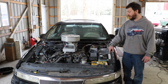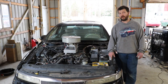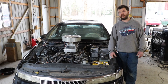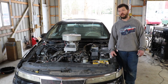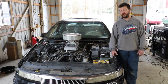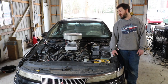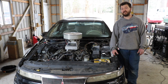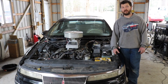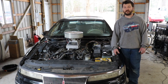We tried a 600 CFM vacuum secondary carburetor that I got from Mike Floater — I appreciate that. Took it apart, cleaned it up, put it back together, set to factory specs. Ultimately it didn't work either. It had a better low-end torque curve, but without a metering block in the back of the metering plate I couldn't control fuel up top. We ran out of time — this thing needs to go away. The next intake will be significantly different and more up-to-date. I'll use the plastic IMRC like a Cobra Mustang, and I already have the intake manifold from a 98 Mark 8 that I'll be cutting up and making that intake from.